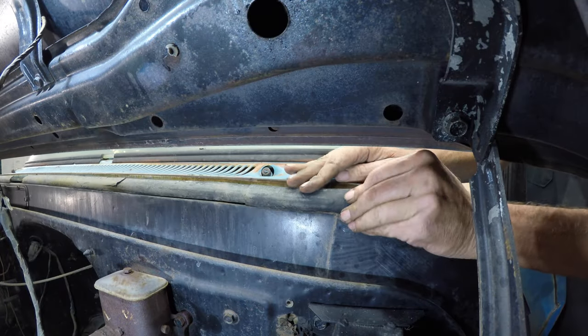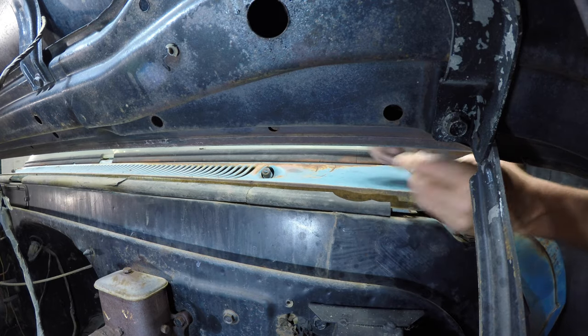Now when you're doing this kind of a job, think about all the peripheral things you're going to need at the same time — wiper arms, you're going to want to get this cowl rubber right here. You can see when it gets this old, it just simply breaks right off. So get all your peripheral setup, get your smooth cowl, and then all you're going to do is just simply take off your wiper arms.